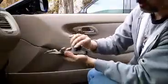I'm going to roll the window down because that makes it easier. So the first thing you do: pull here, pull out and then pull down. If you do it the other way, you'll bend these clips or break them and then it won't fit properly.